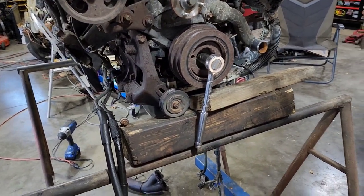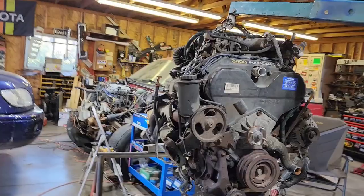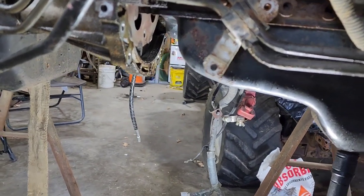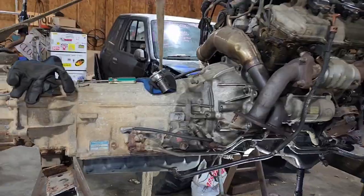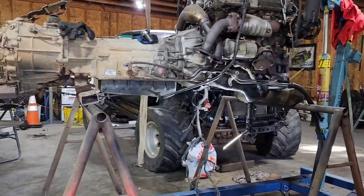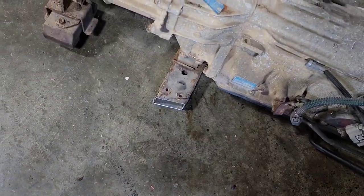Be mindful when you're turning your crank that you're turning it clockwise because you don't want to spin the engine backwards. After you've spun that crank around and taken all six of the bolts out of your torque converter from your flywheel, and they're all on the floor there together — what you've got next is a 17, 17, 17, 17, another one up top there. I can set it down on the floor at this point and get it off of this crazy concoction. Here's another top tip from Fun Junkie Garage: leave that much of your crossmember on, or if you don't want to cut it, they come apart like that.